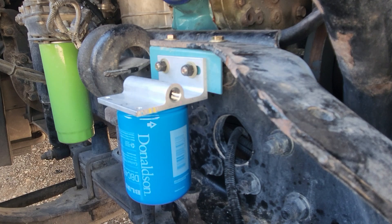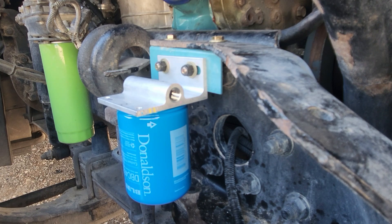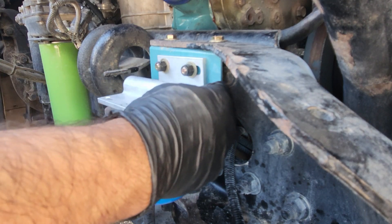That's just going to be overall better for the life of the engine. It's not particularly normal to have metal in your coolant, but in my particular case it was very little — it wasn't a whole bunch — and it was because of the water pump failure. But still, just contaminants — it filters all your coolant. Out of those components, all that stuff floating around in there. And it's just overall better because a lot of these coolant galleys are small, so you don't want to clog them up.